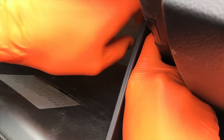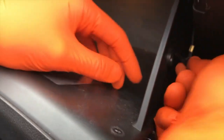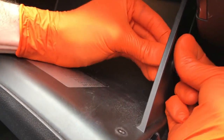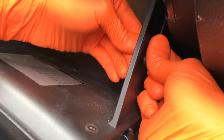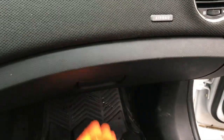At this point both internal clips are in. Carefully grab that tension rope — we did not want to lose it or trap it during the install of those clips. Focus on this little hole right here — all I'm going to do is insert it in, grab it, and continue pulling it through. Put that copper portion of the tension rope in — and it's in. On both sides the internal portion locks itself into place. From here, test your glove box.